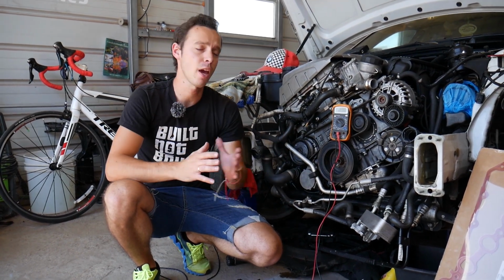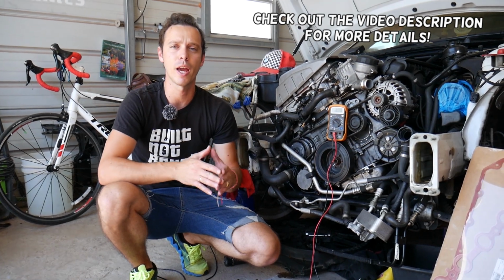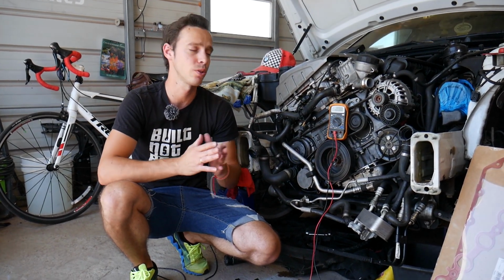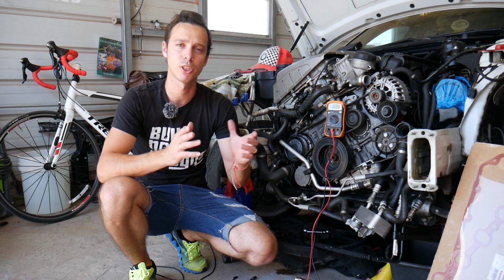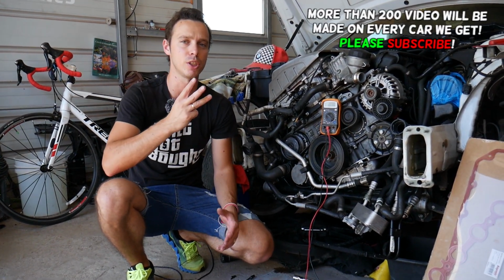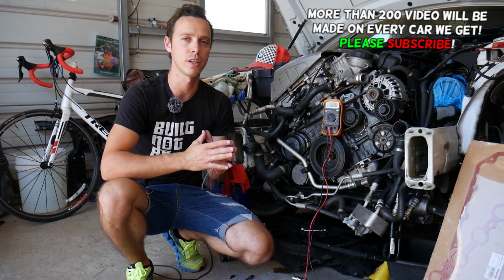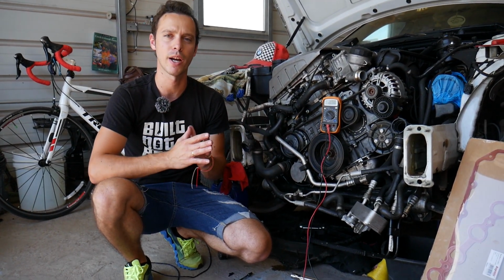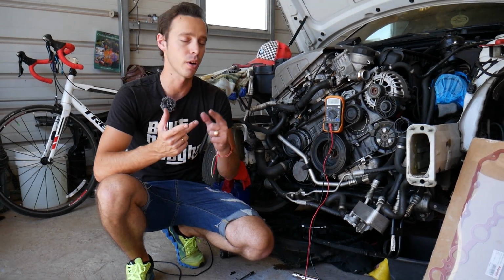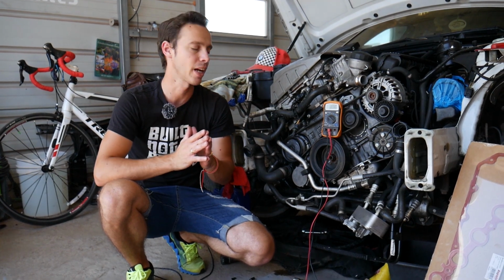Today will be a super helpful video for any of you having a BMW Z4 who needs to test your camshaft position sensor. Let's say you have a 4- or 6-cylinder engine. The procedure will apply to all of that, and we will explain how to identify your camshaft position wires and how to test the sensor. Why buy a new one if yours is good? Because the problem could be somewhere else, such as a fuse, a broken wire, or even a bad engine computer in some cases. So stay with us and we'll explain how to do that.